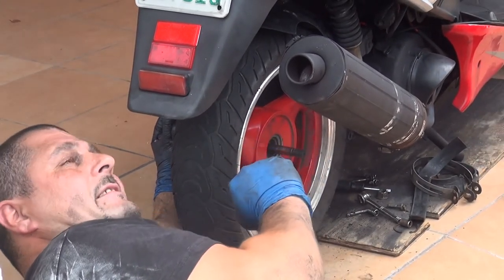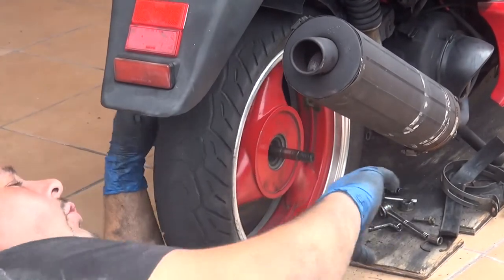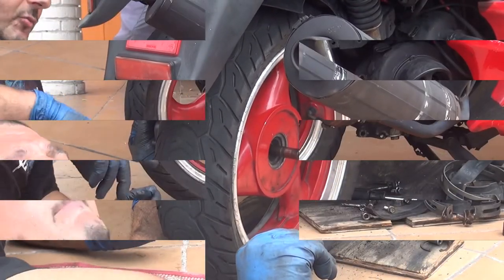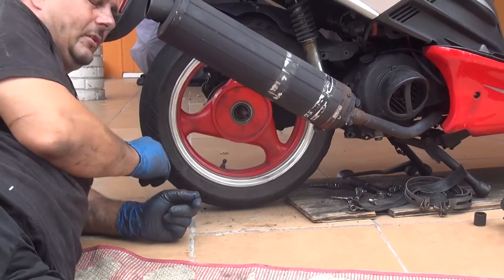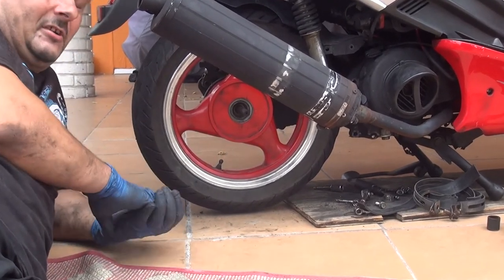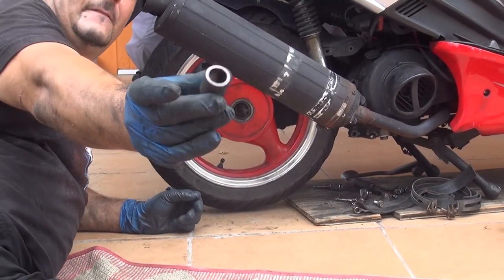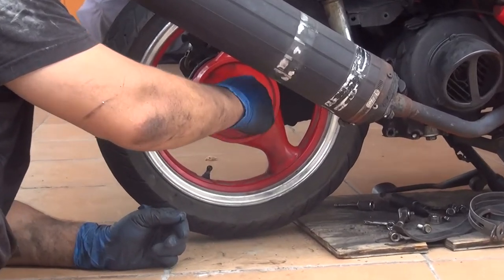The new brake pad. At this point, if the tire is turning freely, we can start to put the O-ring back, we start to put all the washers and everything where it's supposed to be, okay? At this point, we can make sure everything is nice and your tire is turning freely. We can put back the washer that was there, the spacer actually, this is the larger spacer. That's right here, that's the larger spacer, okay? For the back wheel. You can place it back here.